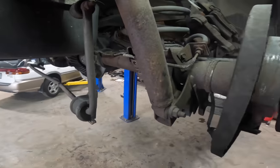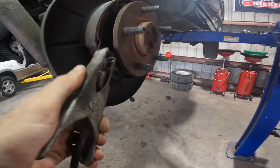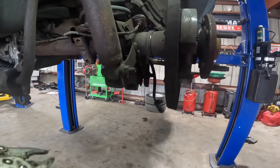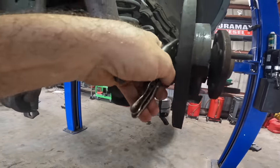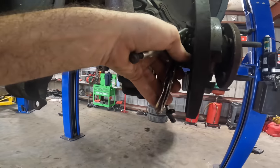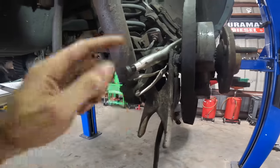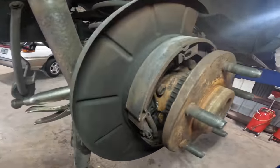One of the first little issues I'm running into here is I'm having a hard time attaching my ground cable to anything to get a good ground. So what I'm going to do is vice grip some vice grips to those studs and then connect the ground cable to my vice grips — it's just going to give me some more surface area to get a good bite and make a good electrical contact with that stud.